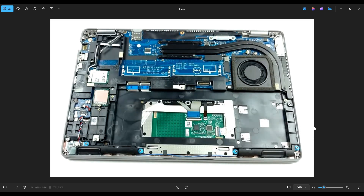Now that the battery has been removed, or again at least unplugged, it's safe to proceed deeper into the computer. Your CMOS battery is actually kind of hidden — it's underneath here in the bottom left-hand corner of my screen, underneath this black plastic panel. We're going to need to remove this screw here because under here is our CMOS battery. It's wrapped in black electrical tape and held down by double-sided tape, so you can easily pop it off. It plugs under the motherboard — the cord goes out of here, winds under here, and plugs into the motherboard right there.